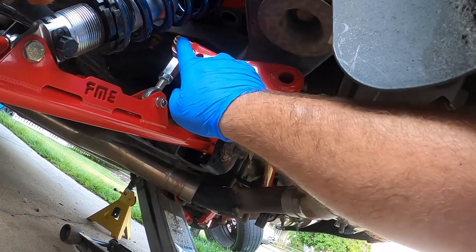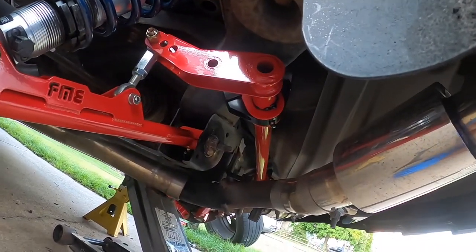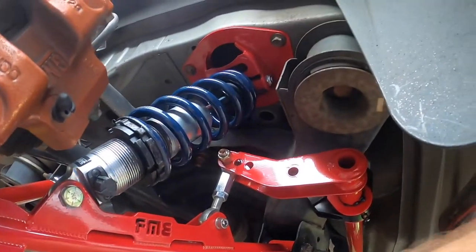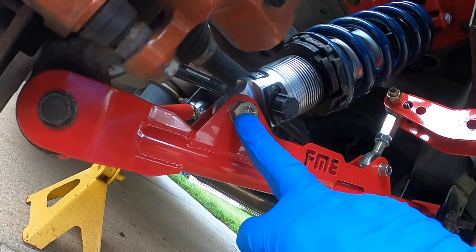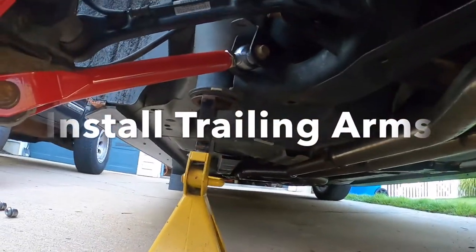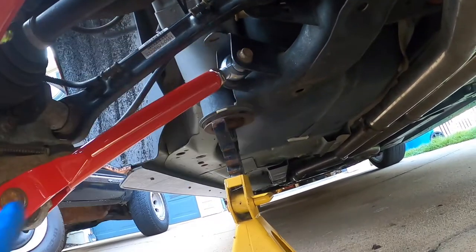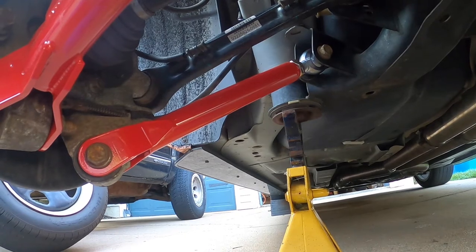You can always make adjustments as you go — they make it nice and easy to access everything. We took the lower control arm and installed it — started here, just let it hang. Put all these in loose, swing it up, put all these in loose, put this bolt back in — that's your original bolt, and this is supplied hardware. The last thing you have to do is put your trailing arm in — reuse your old bolts. They're adjustable, so just set these to the stock length and that'll get you really close. You'll definitely need an alignment.